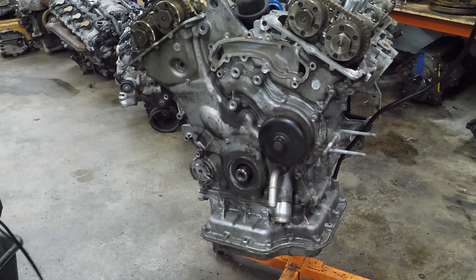This was an engine from a wrecked vehicle — probably had low miles on it and it sat for some time after it was wrecked. Once the engine was pulled from it, it probably sat even longer. Either the yard or the customer got it and realized it wouldn't turn all the way over. I don't think it was installed into a vehicle because you couldn't get all the torque converter bolts in. When they realized it wouldn't turn all the way over, they tried a few things and threw it in the core area. That's when I bought it. I tore down a good engine, but I didn't know it was good. Any time you try to turn an engine over and there's resistance, you risk damaging internal components like rod bearings. I was not born a gambling man, so I'm not going to sell somebody an engine I am not 100% confident is good.